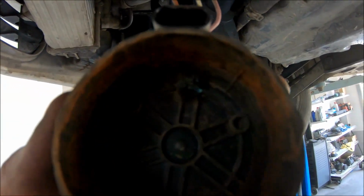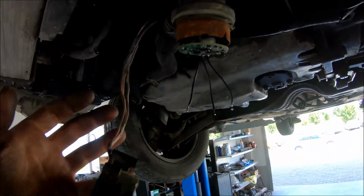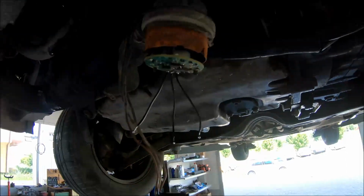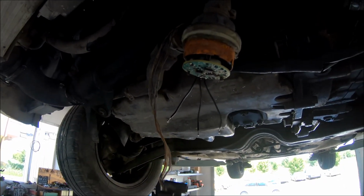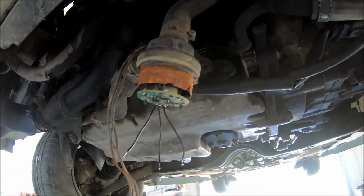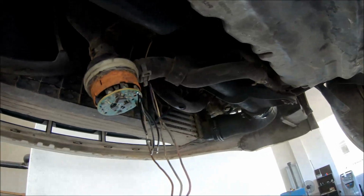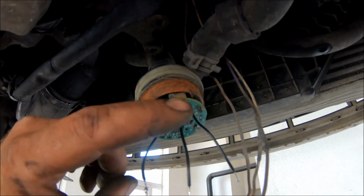also the second pin was damaged again from corrosion, because it's on the lower side of the engine, and when winter comes, it creates a lot of condensation inside, and it damages the pins. So now you can see I have put new wires into the holes.